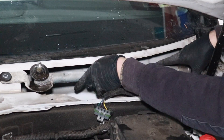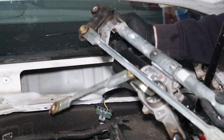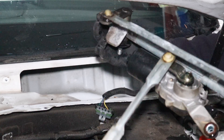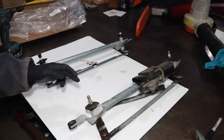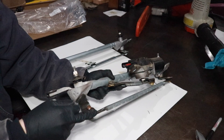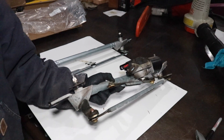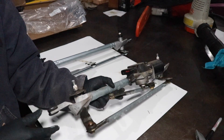Let's pull this assembly out of here and see what's going on. There's your problem — linkage failure. So it's the next day. Here's the old linkage and motor assembly. I was hoping to reconnect the linkage back together right here where it's separated — this is a ball and socket joint. I could have drilled and tapped that, but who knows how long it would have lasted.